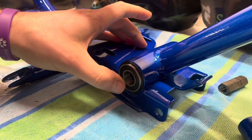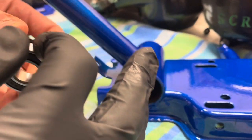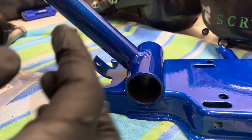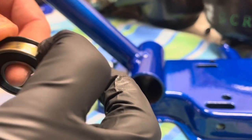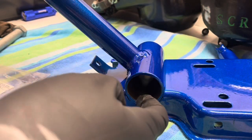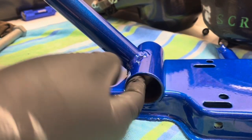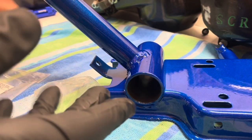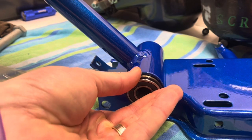One side's in — let's flip it. Yeah, these were all bad on the bike. The jack shaft bearings — it was just wobbling in there. It'll be much happier going down the road after these new bearings are installed. It'll probably feel almost new. I mean, I'm basically making it a new bike. Besides the engine — that's staying original, I'm just going to touch it up. It probably could use a little motor rebuild, but it doesn't smoke or burn oil, so I'm honestly not too concerned about that. You can always pop the motor out any time to work on it.